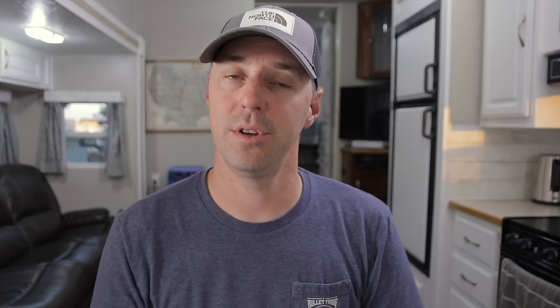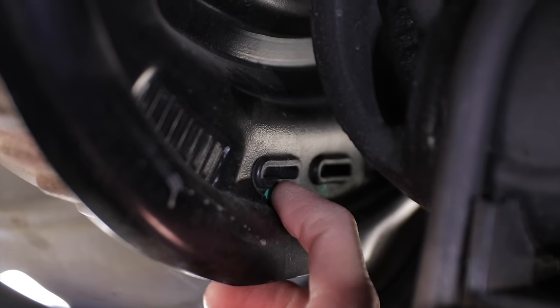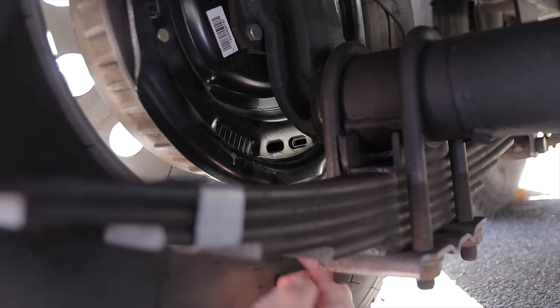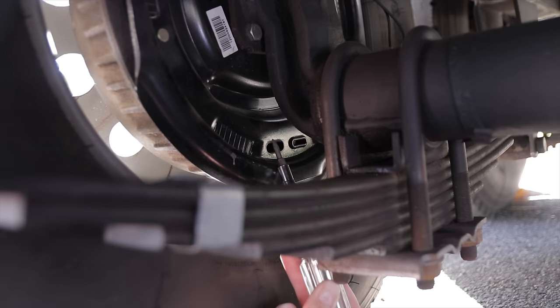For typical brake maintenance, if you're not replacing the entire assembly, you want to adjust it so the magnet is checking out good and there's enough brake pad to last another year. You want to adjust it so that as soon as you press on the brakes, the pad is contacting the outside of that drum. There's a little port on the back of the brake assembly that you can pop off, and then you can stick in a brake spoon to adjust that device and move the brake pads out so it contacts at the earliest possible time. You can also use a screwdriver instead of a brake spoon. You need the wheel on to see how it's spinning, which is why you use that back port.